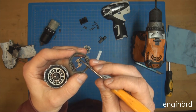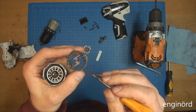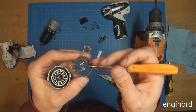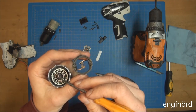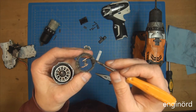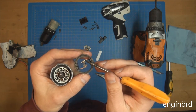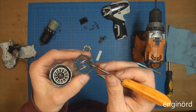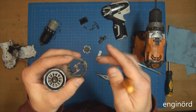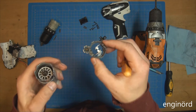And as this piece heats up, the stiffness goes down, but it still has to act as a spring. If this doesn't act like a spring, then the brush doesn't have enough pressure against the commutator. So the current goes up, so you've got even more current that heats it even more. So we've got basically structural analysis, thermal analysis, and fluid dynamics analysis, since it's cooling it. It's a pretty complex part, and making it durable and cheap is not an easy task.